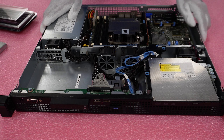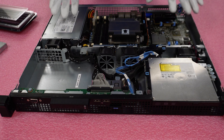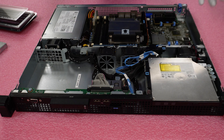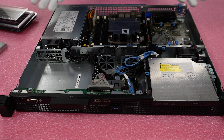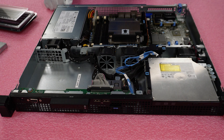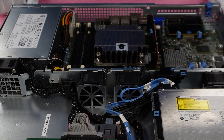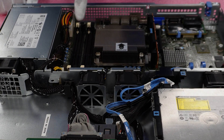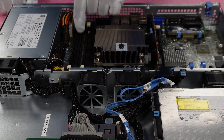One of the things I wanted to point out is that there are two white and two black DIMM slots. What that means is that there are two memory channels and two DIMMs per channel. This is a little brother system that only has four DIMM slots and one CPU. But let's say you were only putting in two 8-gigs or two 4-gigs — where do you put them? I'd say put in four 8-gigs and max this thing out. But if you're only putting in two 8-gigs, you put them into the two white DIMM slots.